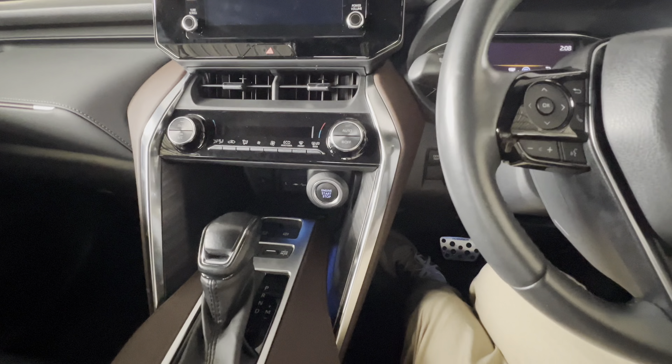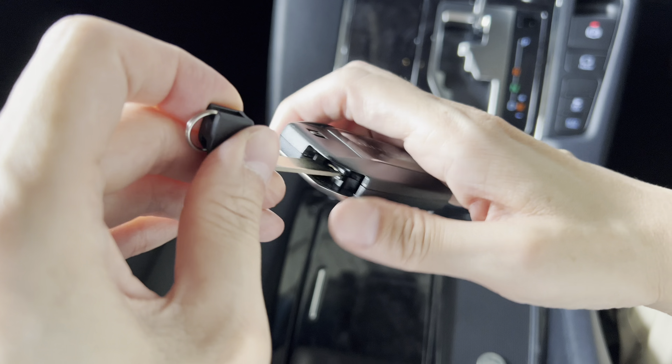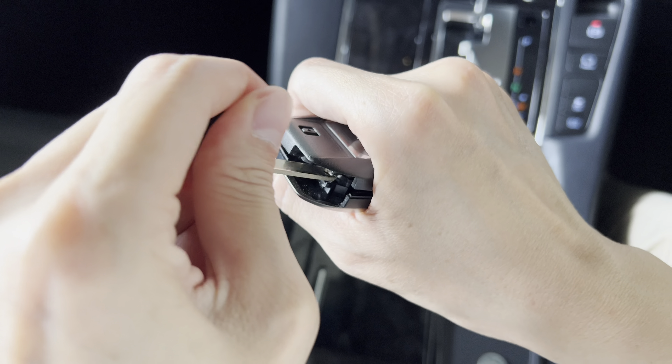Last one — the Lexus. Press here and pull the key out. The key hole for the Lexus is slightly different; it's hidden and facing downwards. To unlock the car, put the key in and turn it. Once you turn it, the alarm will go on — that's normal. Then as usual, press the brakes and press the push start button.